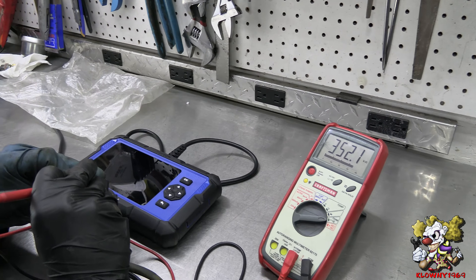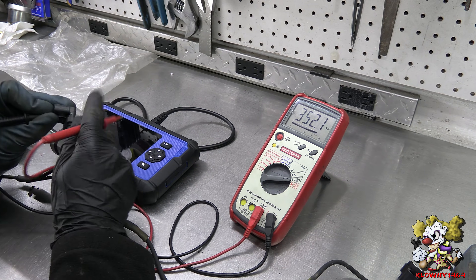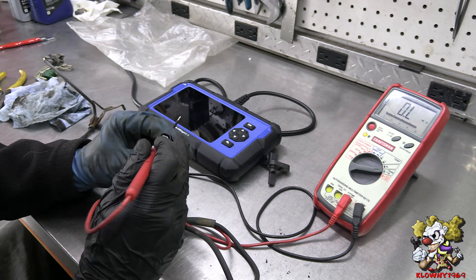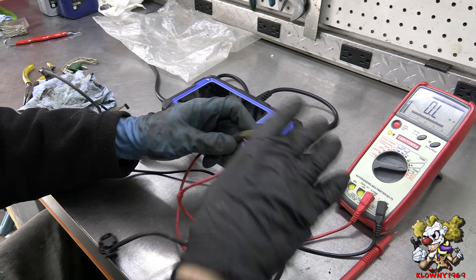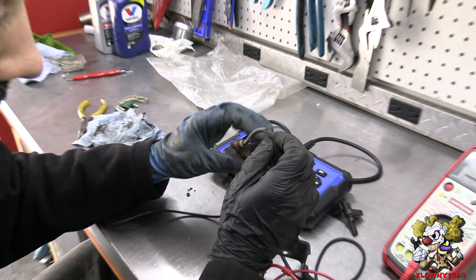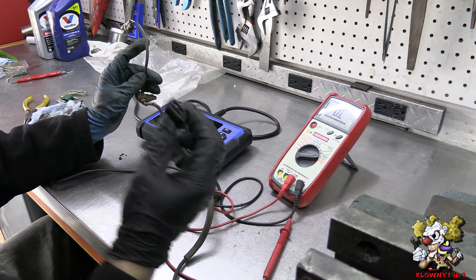Alright, so we found another issue — well, actually the real issue. I took the sensor out and I'm testing it off the car. Now it reads 350 too, just like the other ones. So I tested the wire — I took the wire out and tested it — and we're not getting continuity on one of the wires. If you go from one end to the other you should get continuity, and one of the wires didn't. So we looked at this closely and there's a cut in the wire. We're going to take this apart and fix the wire, or maybe just order a new wire. That's the issue here. Never rule out a wiring issue — it's most likely a sensor, but never rule out a wiring issue.